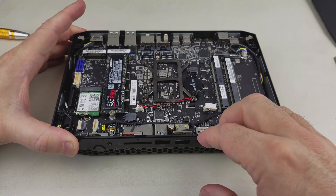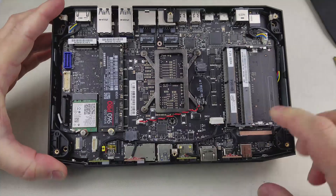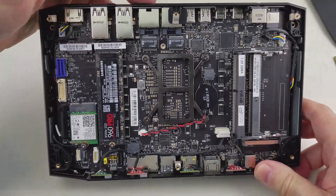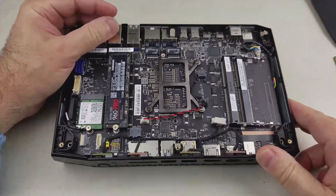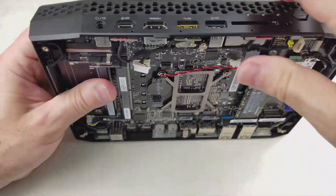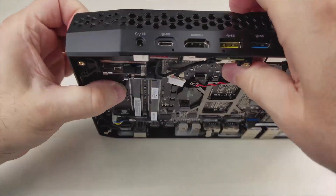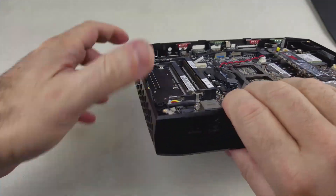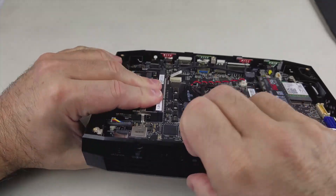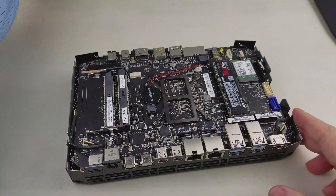The motherboard is actually loose but it's captured by the various connectors. The next step is to remove the plastic piece, and then we'll be able to get the motherboard out. The microphones are now out. The motherboard is loose but the Type-C connectors, RJ45, and HDMI are holding it in place. The easier way to get it out is by turning it — one end is easier to remove than the other — just bowing the plate and working it around until this whole piece comes up.